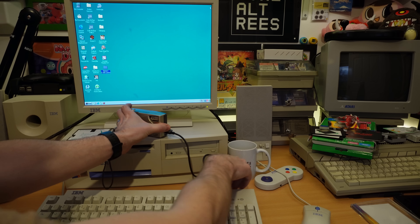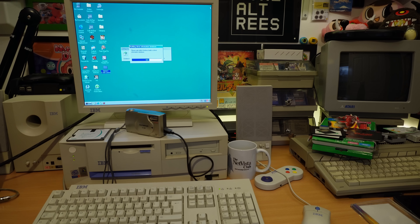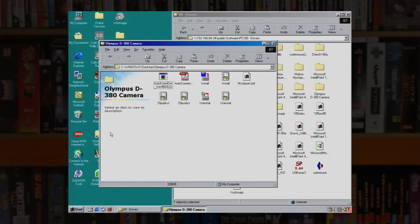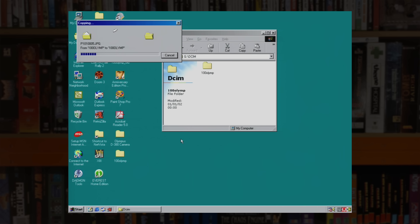As a basis for comparison, I thought I'd try out USB, as this later camera and PC do support it, and that involved tracking down proprietary drivers. As it's quite common for these early devices, it doesn't connect as a mass storage device. Thankfully, Olympus' Canadian website still happens to be mostly stuck in the early 2000s, and although the download link had fallen victim to bit rot, I did manage to rescue the file from the Wayback Machine — and of course I'll also link that down below. So our 8.4MB of files took 4 minutes 15 to transfer using the FlashPath, while using USB — admittedly on a camera and machine that date to around 4 years later — the same transfer takes 14 seconds. Progress!